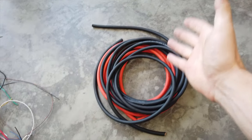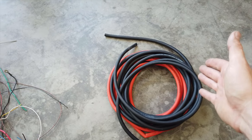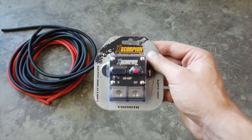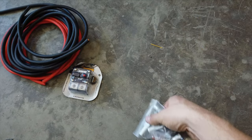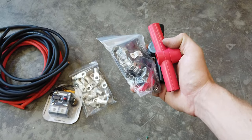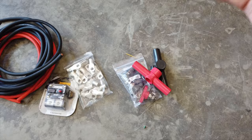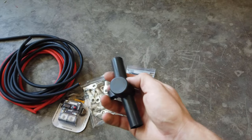I have a bunch of positive and negative power wires in 4 gauge - I didn't feel the need to go higher because that's the standard size Subaru uses. I'm going to use this 200 amp circuit breaker, which acts like a fuse but lets me reset the system without changing any components. I've also got a bunch of 4 gauge welding terminals and a positive and negative isolated terminal post, which I'll use to disconnect the rear cables from the front. They come with isolation boots, which is really practical.